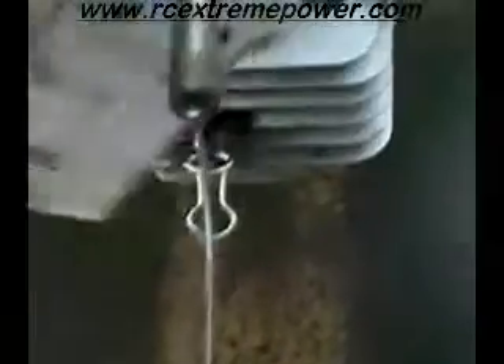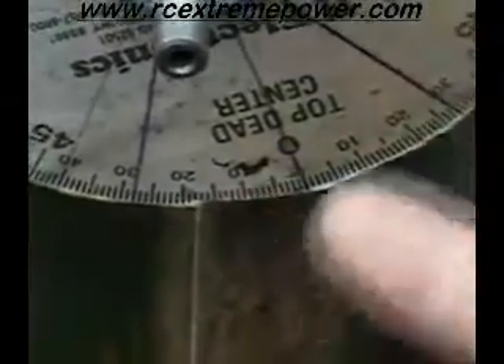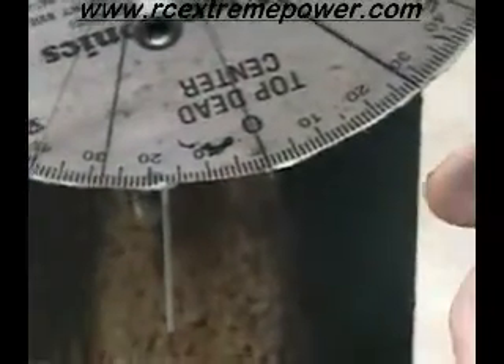Now I've got to come around this way — stopped, 17 degrees. So that shows you: use the piston stop, or if you're comfortable and you've got a good feel, you can find top dead center just with the rock of the engine.